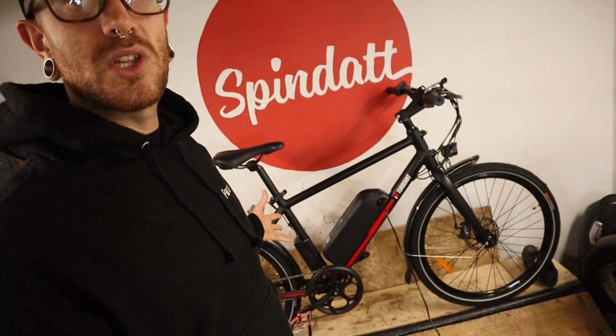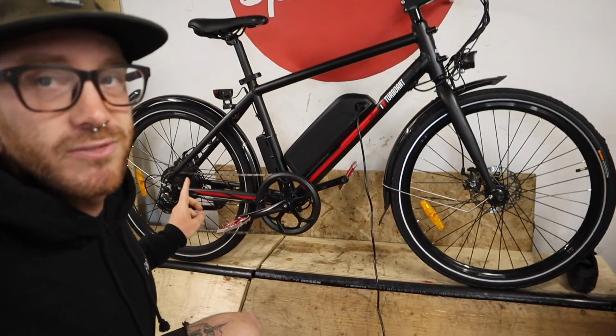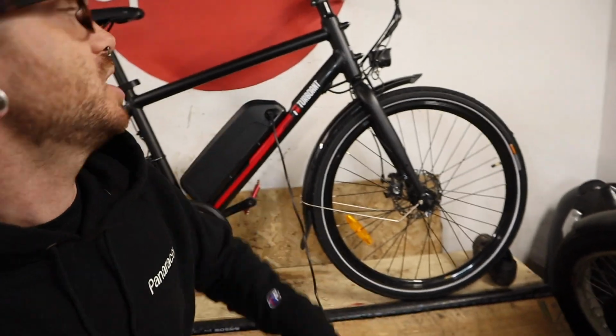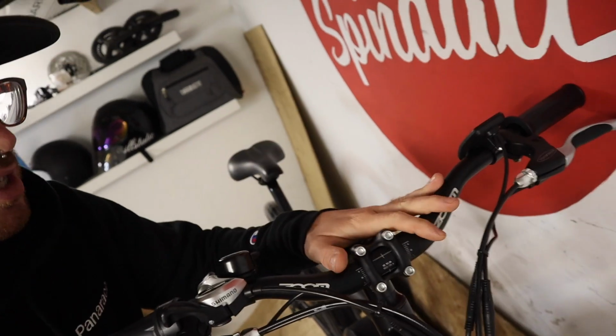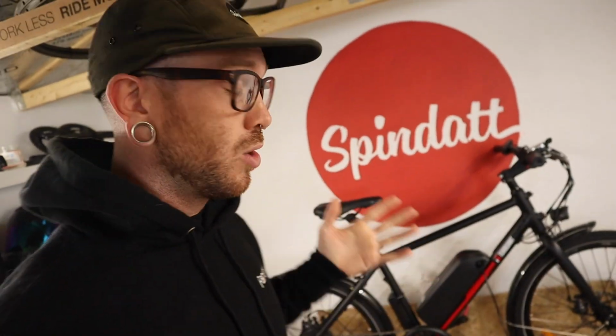I really start to focus on the stuff that I am familiar with. And I'm like, okay, aluminum frame specifically designed for e-bikes, along with a nice flat space for the battery to sit on. That makes sense. Aluminum fork, keeps things light, that's good. Wheels, huge spokes, that makes sense. The bike's heavier than usual. Your typical oversized bar, not super great grips. Mechanical brake lever actuating some entry-level Tektro disc brakes. Quick release seat post clamp, which is good. That means Angela can jump onto this thing without having to use any tool. But a bizarre 30.4 millimeter seat post diameter. I don't really know why.